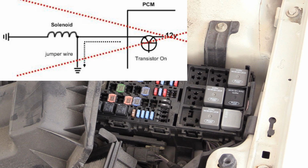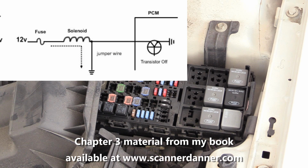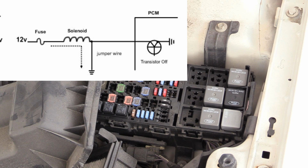I hope that's clear. Power side switch circuit, if the driver's on, computer sending power down the line on the control wire, and I have the control wire modified in a way that I can manipulate it. If that copper wire would touch ground on a power side switch circuit, you would cook the engine computer. On a ground side switch circuit, not the case. Touches ground, we just energize the relay. If the computer happened to already be energizing the relay, giving it a ground, we would just be giving it another ground. Again, we wouldn't hurt the circuit. So I wanted to point that out. Jumping relays can be very dangerous, and you guys just need to be aware of that. Again, all stuff that I cover in my classes.